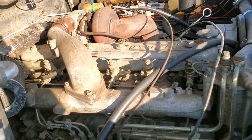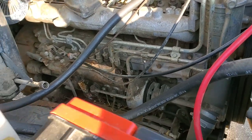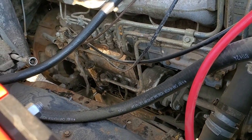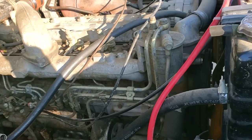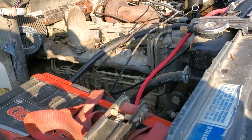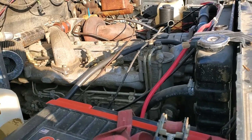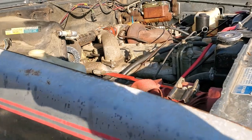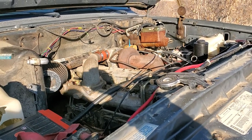Give me some comments if there's anything more you want to see or if you have any questions. I used the diesel pump off the 6BG1T because it was for a turbo — the one that was on here was for naturally aspirated, and I didn't know if it would fuel correctly for the turbo. Timing them is a cinch — not like a Cummins, it's very easy. Another beauty over the Cummins is that this is a wet sleeve motor, meaning it's infinitely rebuildable provided you don't roach the bottom end. If it starts to wear or scores a cylinder, no big deal — pop the head off, pop the oil pan off, pull the sleeve, put in a new sleeve and piston. A rebuild kit for this on eBay runs roughly $900 and that includes everything: sleeves, pistons, rods — everything but a reconditioned crank.